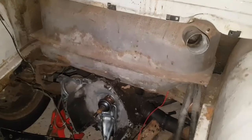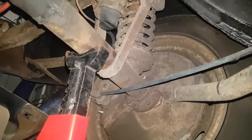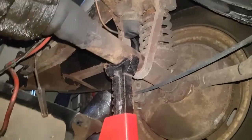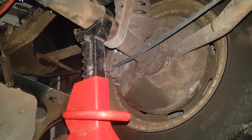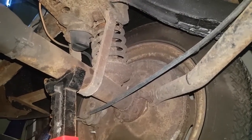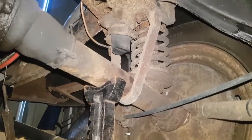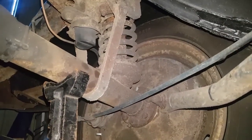Mine's also got 20 litres of diesel, which is 20 kilos worth - great. So as we can see, you've got a shock absorber and spring assembly there, a strap that actually acts as an anti-roll bar and stops the body of the car rolling away from the axle. Basically, as it goes down the road, the wheel's doing its thing hitting all the bumps, the spring is taking the weight, and the shock absorber is taking away the shock effect of the spring bouncing around. The rubber bump stops you can see there - when it rolls so far the bumps hit the torque tubes, which have basically a half-shaft going through them. You've only got a strap that's there also to stop it rolling the other way.